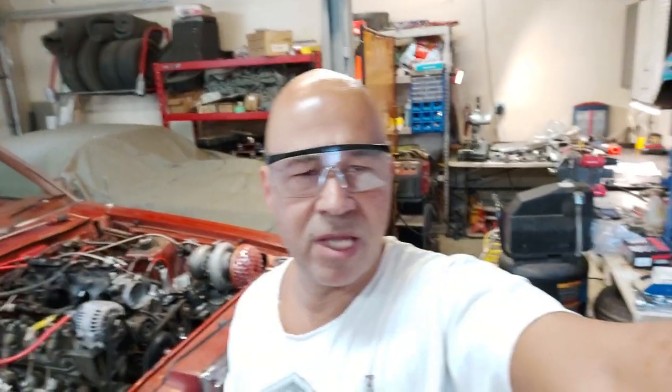All right, guys, so that's just another quick little video about the throttle cable and gas pedal for Project Turbo LS. So pretty simple, pretty straightforward, nothing complicated. Again, just using the factory gas pedal, 36-inch Lokar cable. Pretty easy install. Everything works fine. You got full opening, full closing, so that's what we want. We have nice pedal feel, so again, that's cool. So when we hook up the Terminator X Max ECU, they want us to do a full sweep of that throttle pedal, so that should be no problem.